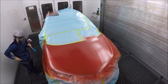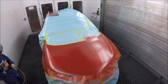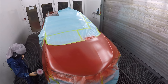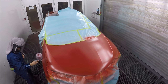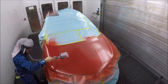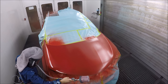Now I'm going to put a second coat. I don't want to fool around with this color, so I'm going to cover the whole entire hood because there were some little chips here and there that were fixed. I want it as uniform as possible. This color is actually a good match on this car, so I didn't worry too much about the color match, but I did want to stay away from the doors.